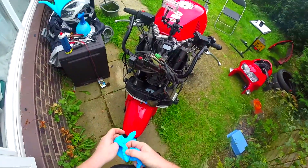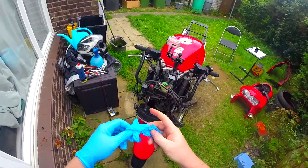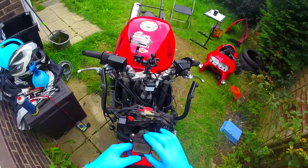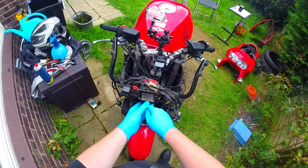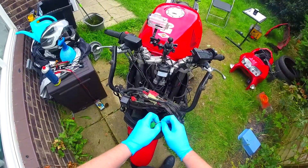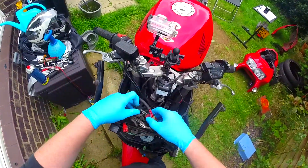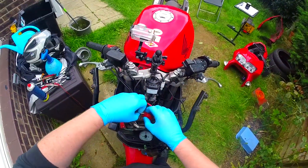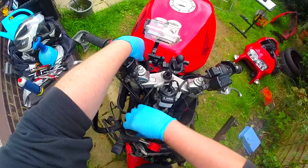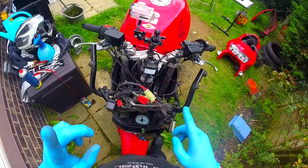If I go around here, I'm going to put my gloves on. It's here. So this is the actual stop-start relay. You see it says 'up', so it goes in there like that. If it tilts at any angle, it's supposed to shut it off. And if we look here, we can see a black and white wire going into this main wiring harness here. White and black. And then if you look here, in this huddle of connectors, we have another white and black. If we trace this one, you'll see it's going to this wire here, which is going to our stop-start switch. So these are the areas we need to examine to see what's going on and where it's going wrong.